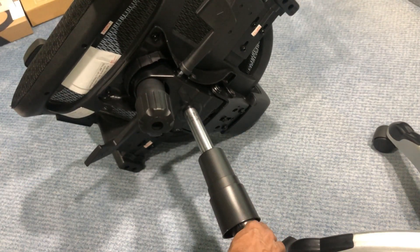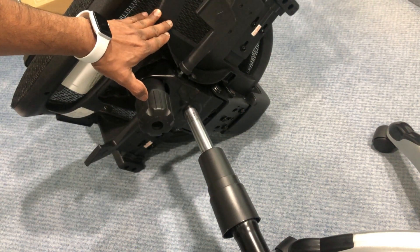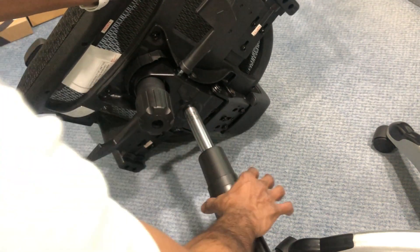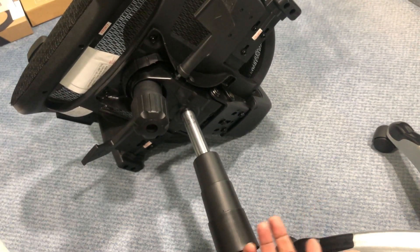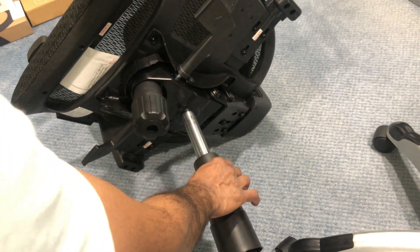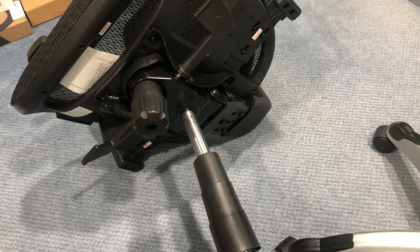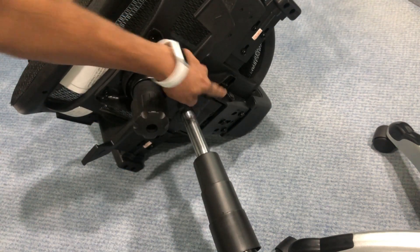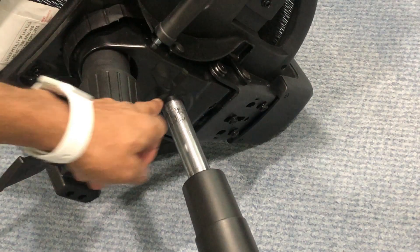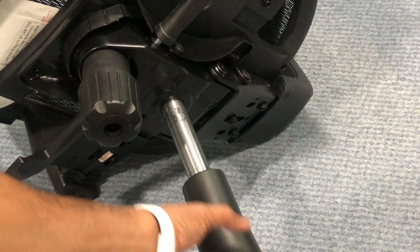In the second step we have to remove the entire cylinder shaft from the chair body. Wiggle it — if it comes out easily, great. But similar to the first step, we'll try pulling the chair base towards you and hitting the hammer, this time on the edge of the cylinder to pull it out from the chair assembly.